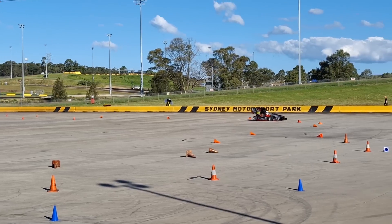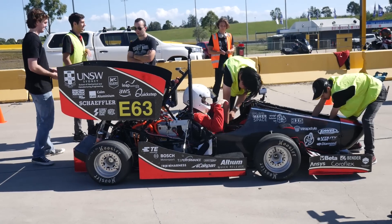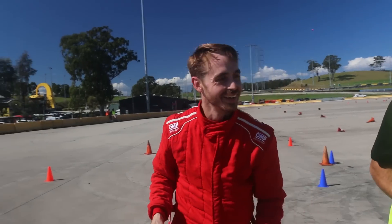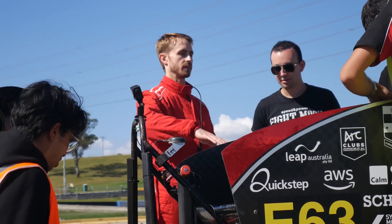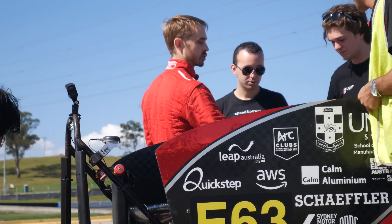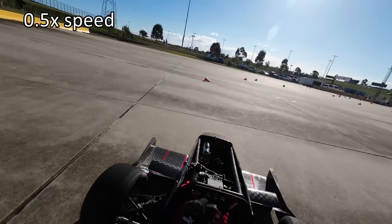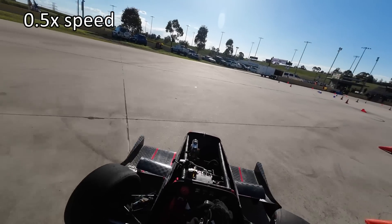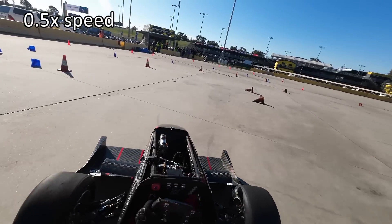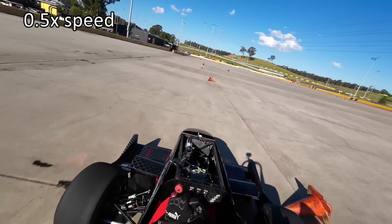That was sick! While a few of you may already know or have seen Formula SAE cars, they don't get car reviews regularly, so it's interesting to talk about some of the characteristics. I'm hardly the gold standard for driving skill but I do know how to find the limits of a car and feel for its overall characteristics. This car has a pretty strong initial turn-in but then it starts to wash mid-corner. Talking to the suspension guys, the suspension has an extremely large amount of toe-out on the front, which gives you that good initial turn-in but then doesn't deal with the problem of pushing mid-corner.